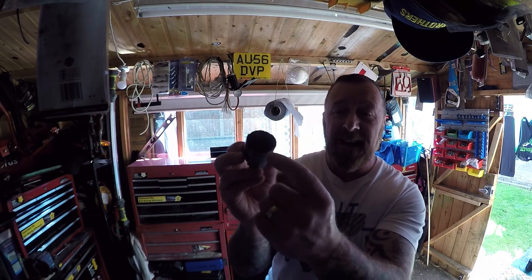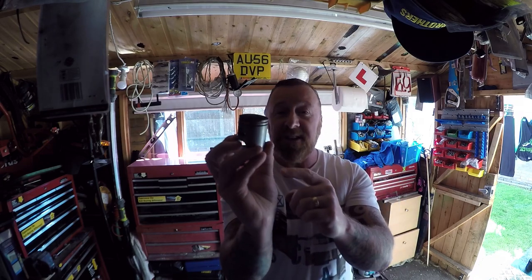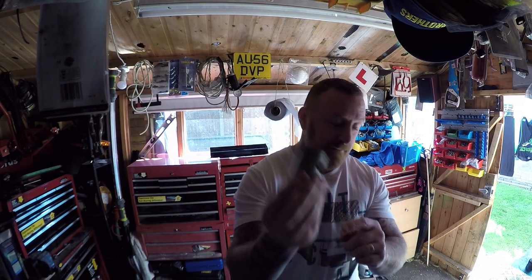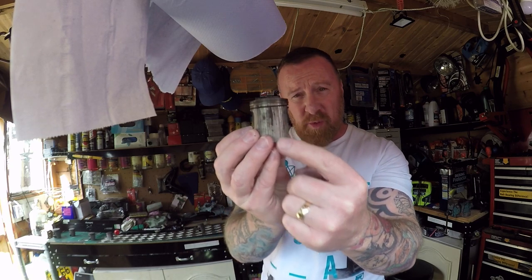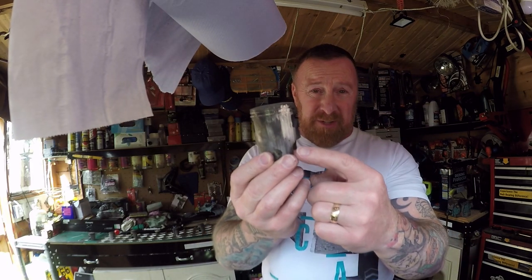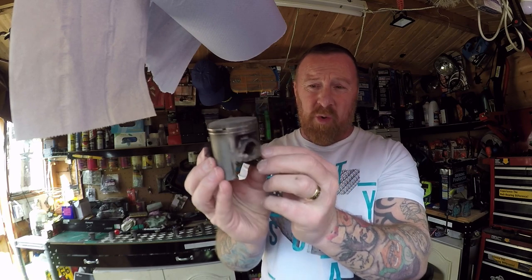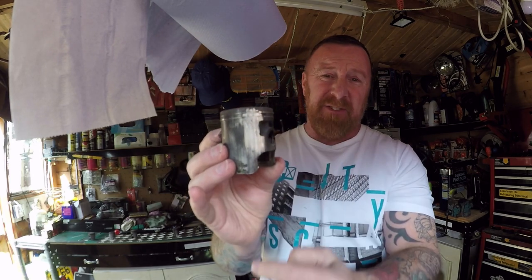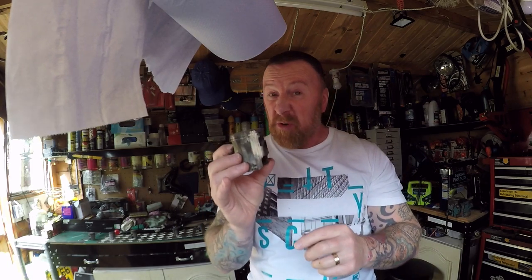Or in this case it's actually started to come away at the sides - you'd spot that, but not necessarily around the sides. If you look around this piston here - this again 50cc - you can see an awful, awful lot of scoring. And even on this one here, a slightly bigger piston, you can see scoring all around it. That is really bad. That's where it's literally locked up, and this would probably not start again.